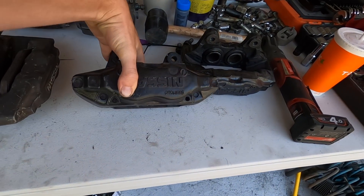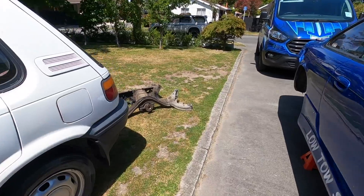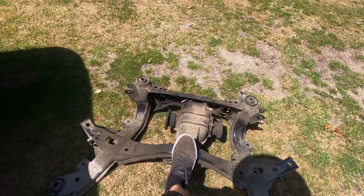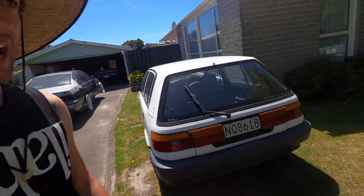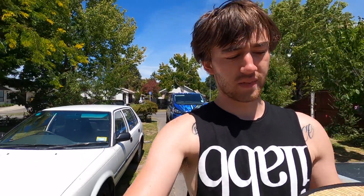That's the color we're going with for the engine bay and I'm super stoked on it. I've also sorted out my caliper situation. I mentioned in the video when we put the brakes on the Sephiro that I'd somehow got two of the same side caliper. These are R33 GTST big brake calipers - if we face them the same way, you can see the nipple is on the bottom on one and on top on the other, so now we've got the correct calipers. I'm not going to chuck those on in this video - I've got the hubs, arms, and knuckles here. This is the subframe going in; it's an R180 subframe - they're weak as, but I'm chucking it back in since I'm never going to use it in another car anyway.